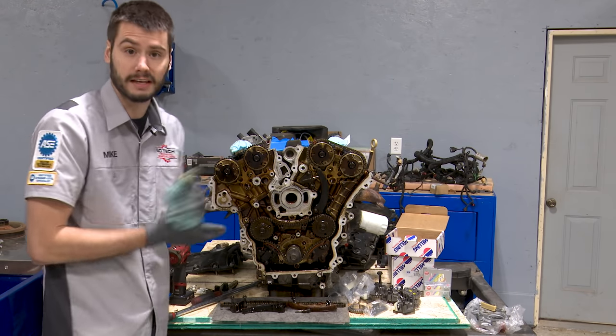There's our primary chain. And now removing the left side secondary chain — there's the tensioner guide, the chain guide, and off comes the chain. There's our secondary chain for the left side. Doing a quick comparison on chain length — that appears to be a rather significant difference. There is definite chain stretch or chain wear on the old chain, at least the one that came off of the left side.